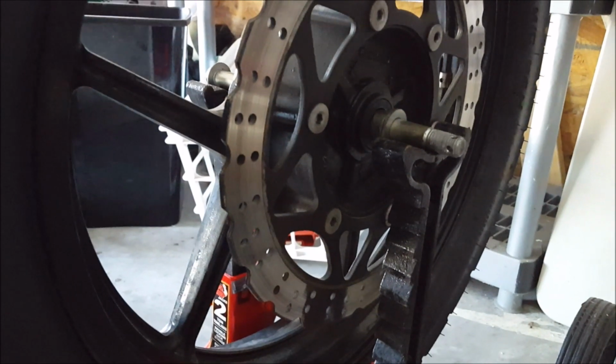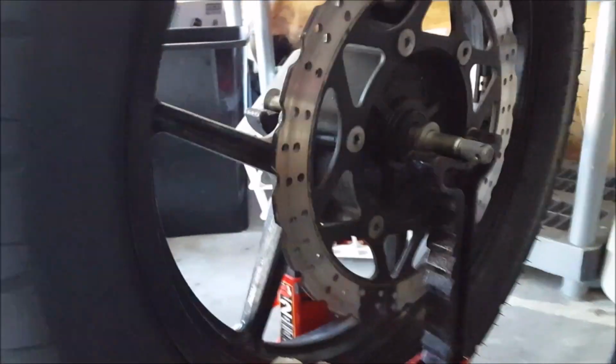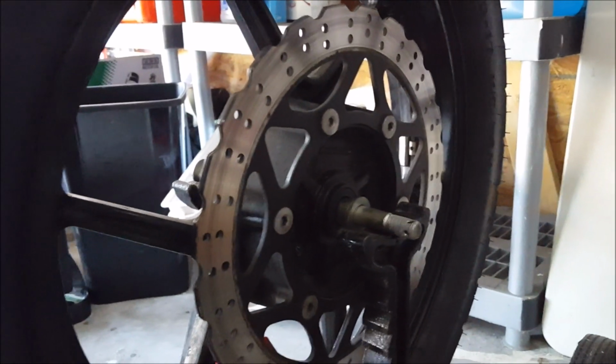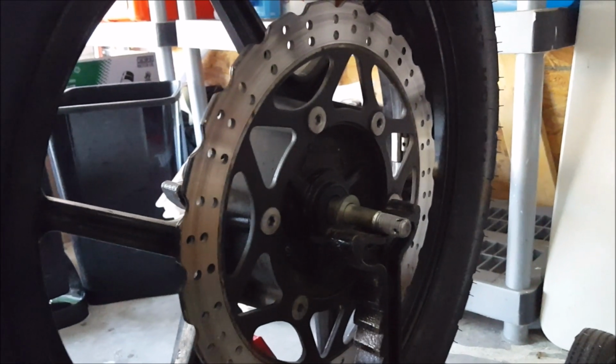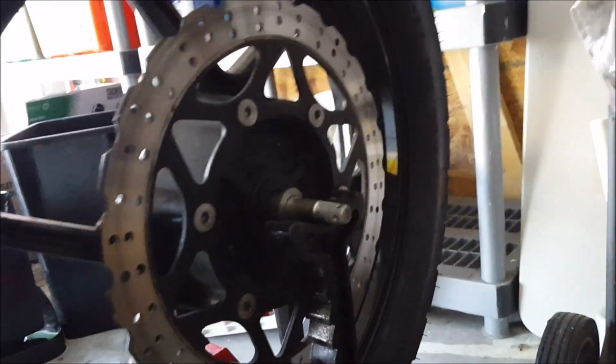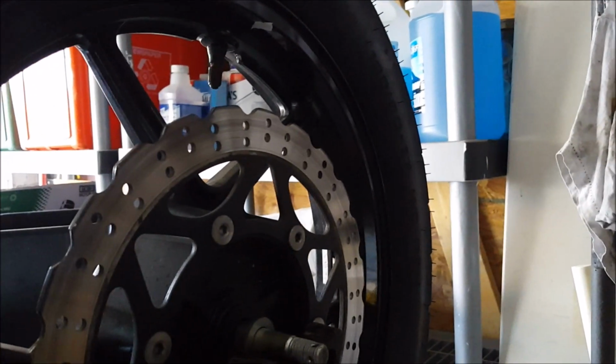You can just use the regular axle, the bearings, there it is, that's the word, the bearings of the original tire. All you have to do is just put the wheel with the axle just like it would be in the forks. And your jack stands act like the forks. You don't even need jack stands. You can use 2 level tables if you can get them kind of level enough.